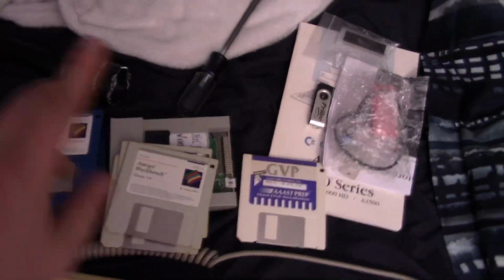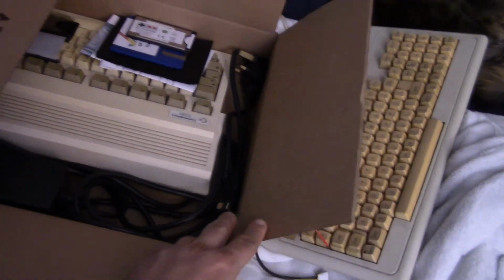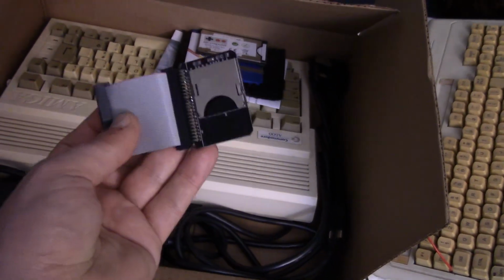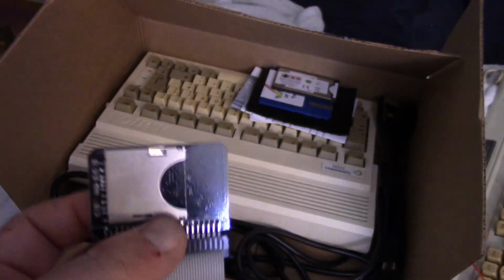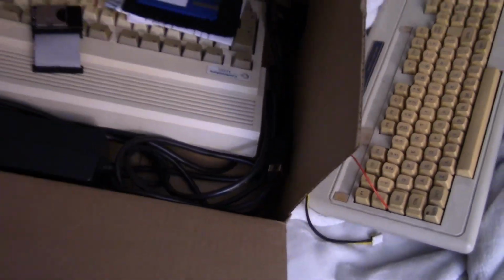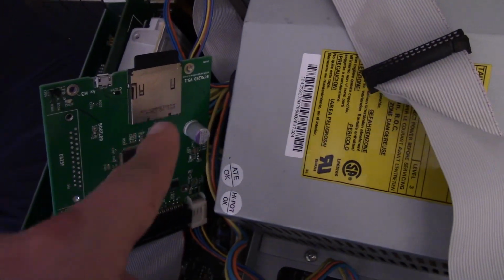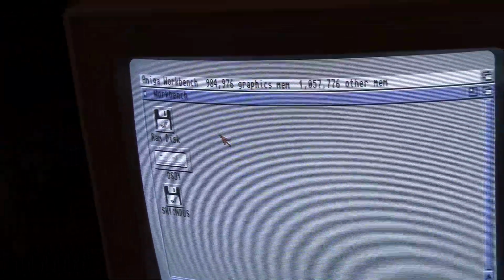And then I remembered, I haven't done a review on this, it's coming. I have a PAL Amiga 600, and I haven't really messed with this thing much. It's really nice, it's been recapped, and at one point I was trying to install, it uses IDE actually, an SD hard drive in that, and I didn't have much luck, but I remembered when I got this little adapter, it came with a supposedly pre-set up SD card. Not sure the legality of that, but I do have the discs, corrupt or not. So I was like, huh. I dug that SD card out and put it in the SCSI to SD card adapter and I rebooted, and lo and behold, it booted right up into OS 3.1. Nice. So I guess we can call that a success.